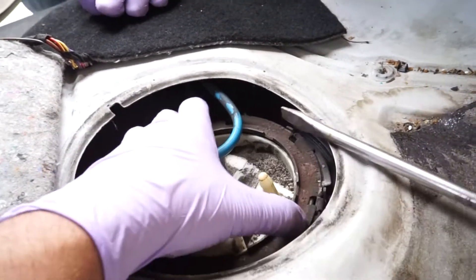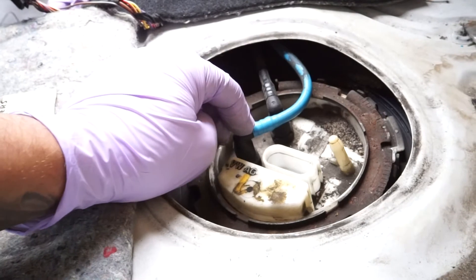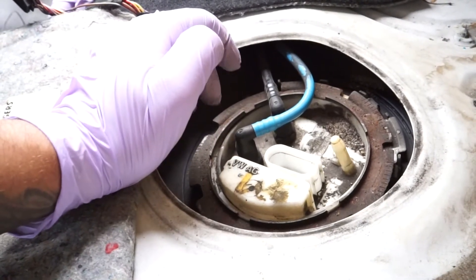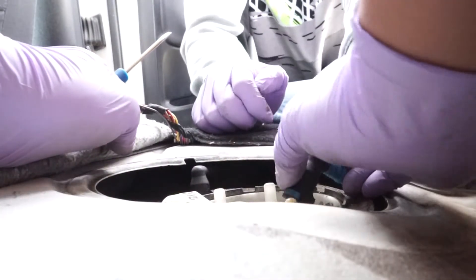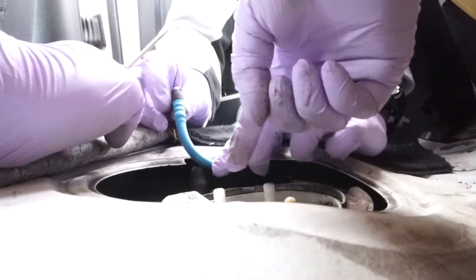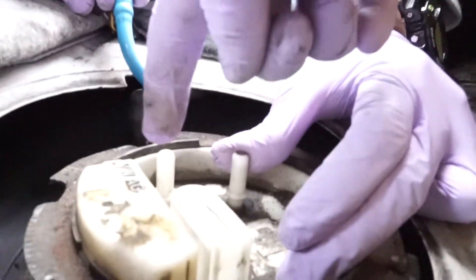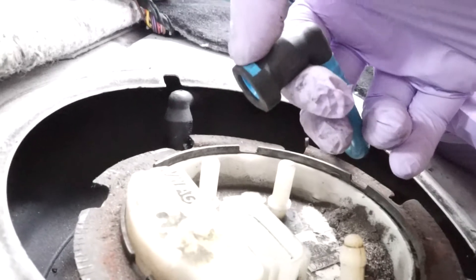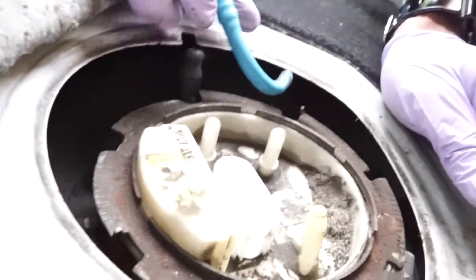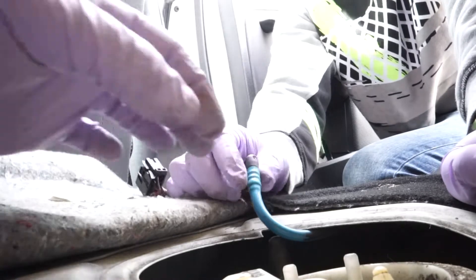What you want to do next is remove this ring, which is locked in this way. What we did was put a flathead here and twisted it so that it could release. Now this is released — we can take off these little hoses that go for the fuel lines and the entire fuel pump should come out. The black goes down here and the blue goes right next to that. Blue, black, blue, black — recording it on video. These tabs on the side: push that blue tab in and slide this out. Take out the ring and the fuel pump should just come right up.